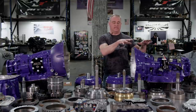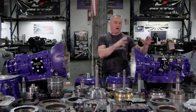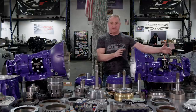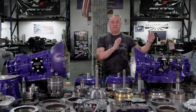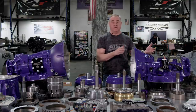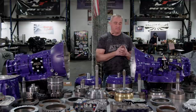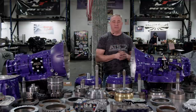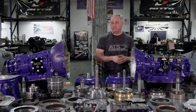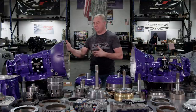In essence, the 68 RFE is a 1500 transmission with all the same planetaries, same gut packs, same clutches — just a slightly bigger pump and torque converter. You can see where that was headed. The entire aftermarket is dealing with the ramifications of an undersized transmission with a less-than-ideal power flow design, particularly in the overdrive section. I'm not talking you out of the 68 RFE — it's a great transmission and we do a ton of them.